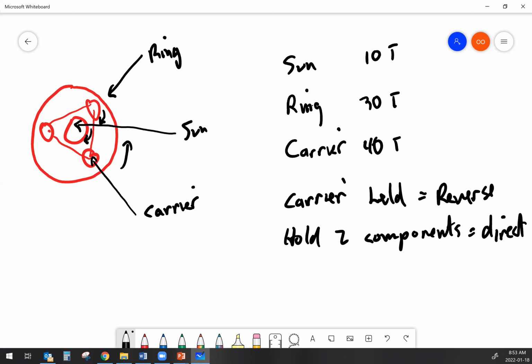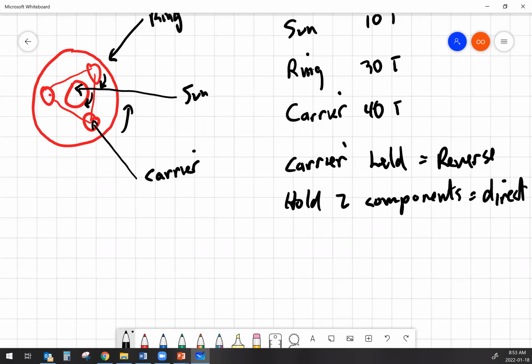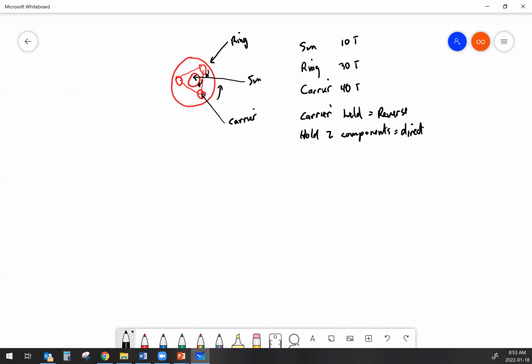Okay. The simplest way to explain what they do with those is they take a planetary gear as a final drive on both sides. That planetary gear set is going to be driven by a crown and pinion gear set, which is driven by the transmission. That crown and pinion gear set does not have a differential in it. So it's interesting that we call it a differential steering system. But it's not actually a differential in there. It's just a solid drive to both sides.